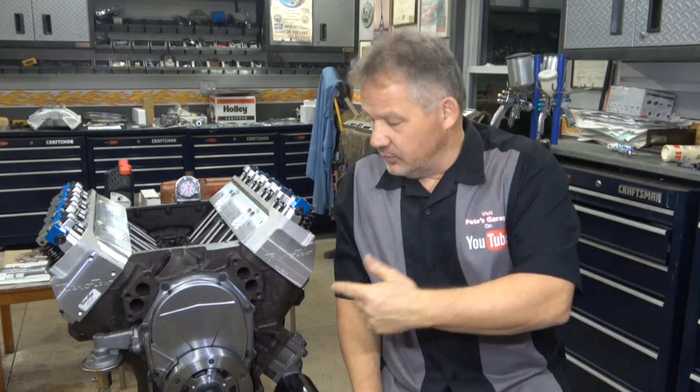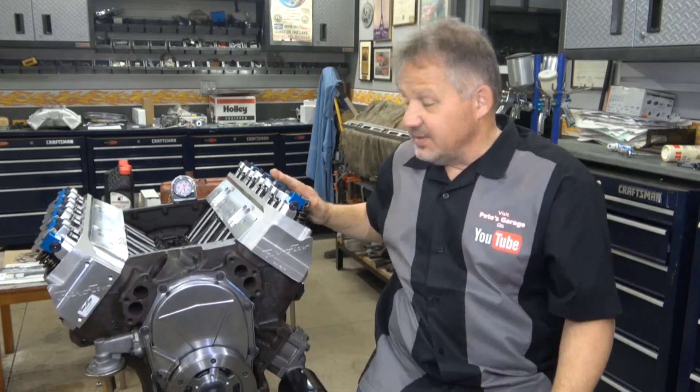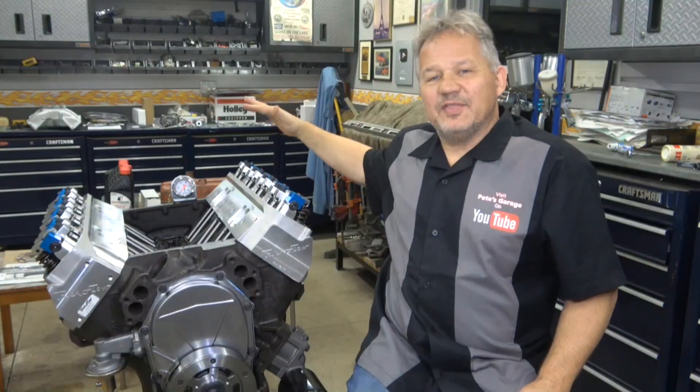Don't run the drill too long in reverse because it takes quite a bit to turn an oil pump when you're pushing 60 to 80 PSI through an engine — if you're using an electric hand drill in reverse it will get really hot fast. Have some help, have someone turn it, make sure you have pressure, and rotate it while you're doing it. I start with piston number one at top dead center, insert the tool, rotate the engine just to make sure I have oil pressure. While turning the oil pump, you'll also need to rotate the engine. The left bank of the engine is going to get oil first, so tilt the engine so that head points up a little bit — once it starts flowing, oil will be gushing all over the place.